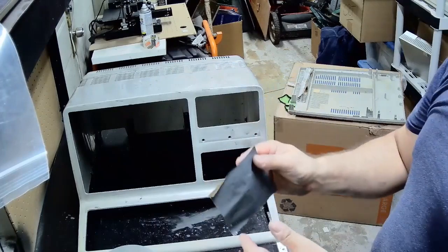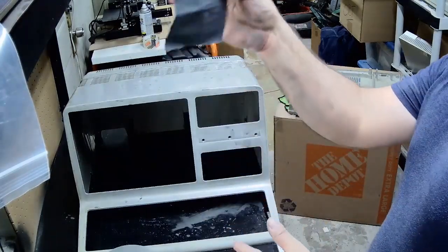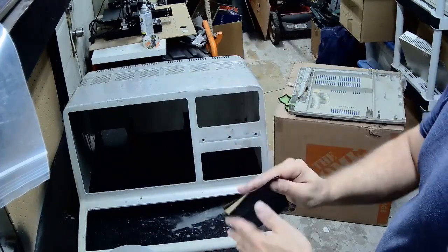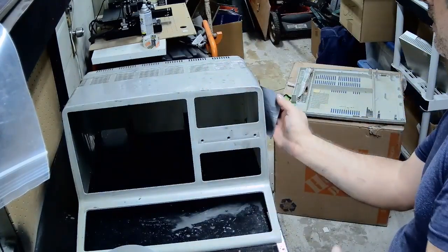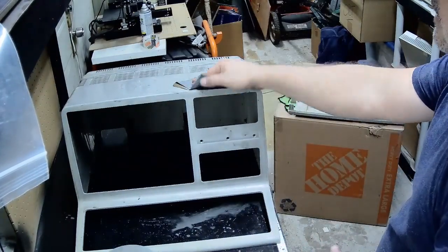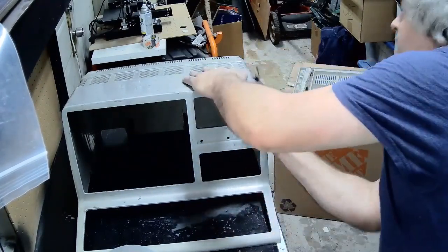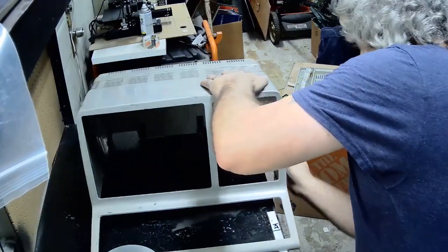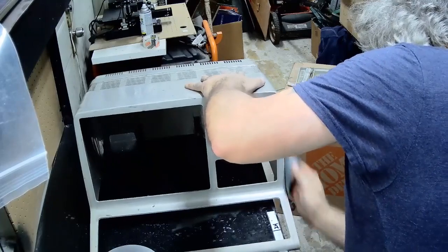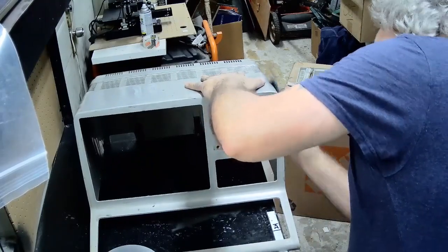And yes, it gets slippery with your hands. The trick: I grab a corner and I use the rest of my hand, so I'm always holding the paper when I'm doing my circles. See, I put it down and I hold this between my thumb and my index. So my hand is like this and I curl just one corner. What this permits me is full control over the paper. Otherwise, you might find that the paper sticks to the surface you're sanding.